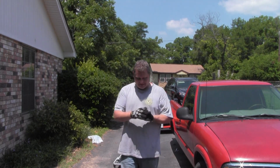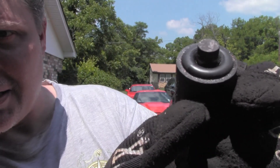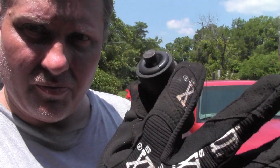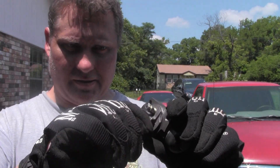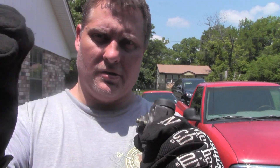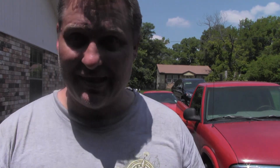Well, there it is. If you look real close, right there you'll see the rip in the boot cover — so this is bad. We're going to put in a new one. Really all we've got to do is take this stop out of here, and then this little stopper here can fit over the bleed nipple and sit right like that, then we go put it on.